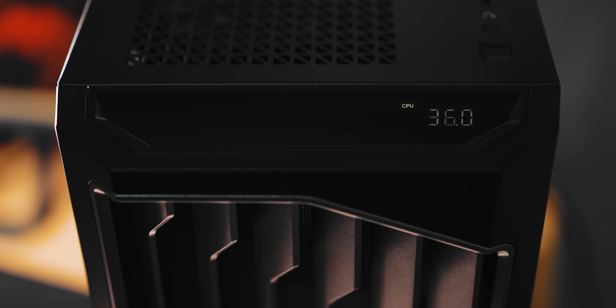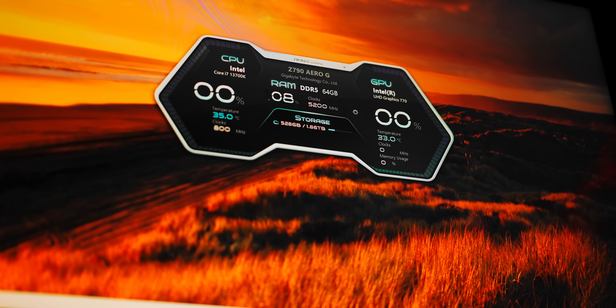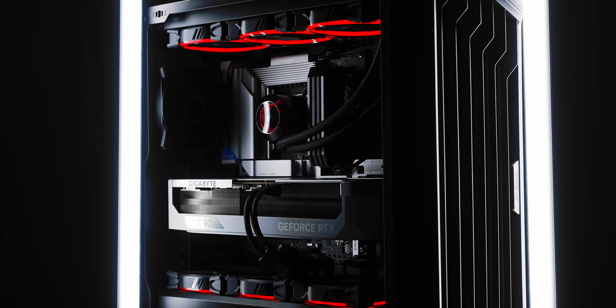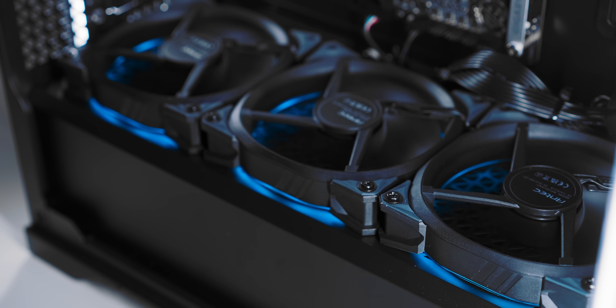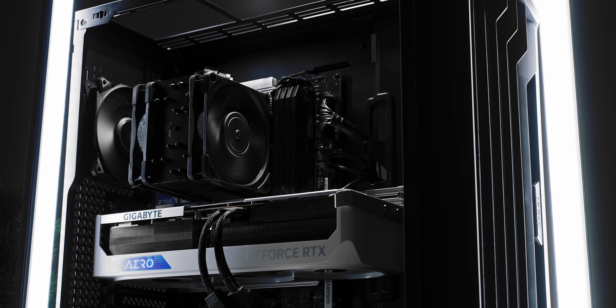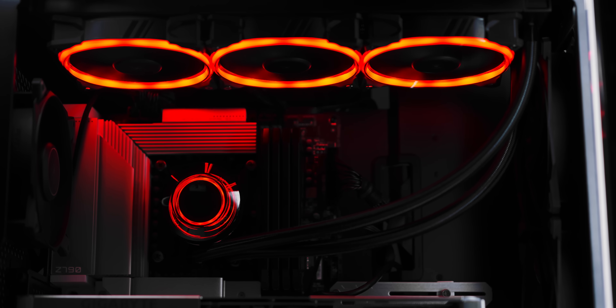I do appreciate innovative features like the screen at the top that can display CPU and GPU temperature. You install the Antec iUnity software that runs in the background and pulls CPU and GPU temps — although you cannot select which GPU you want to highlight the temperature of. Antec, please fix. When it comes to populating as many fans inside the enclosure, it's all about the balance of where those fans go and what RPM they run. If you're buying something of this caliber with excellent front intake, just keep it stock. When you do introduce any restriction to the front panel on a different case, make sure you have additional exhaust, as that has definitely helped in my previous testing.